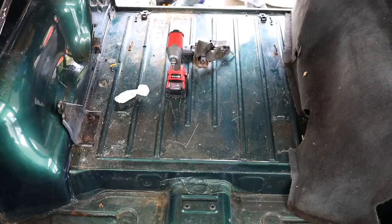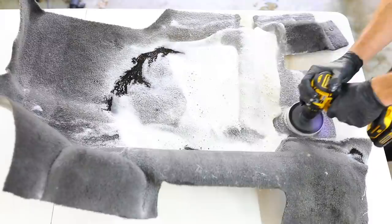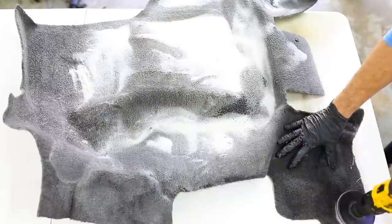Now for the carpets, I'm using two new products, which I'll list in the description box below for you guys. But to start off, I'm spraying everything down with my pre-treatment, and I'm gonna let that soak in, and I'm gonna be using the drill brush to agitate the fibers, get any of the dirt, and get that liquid completely saturated inside the carpet itself.